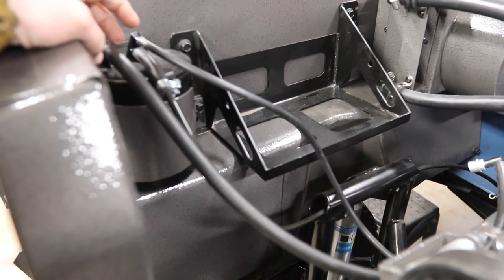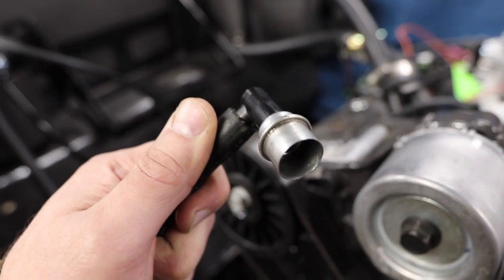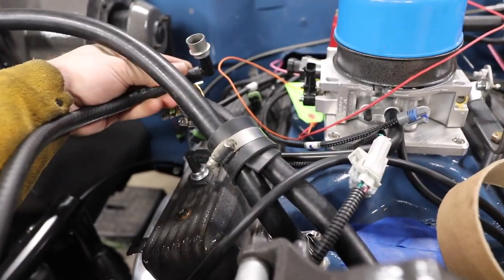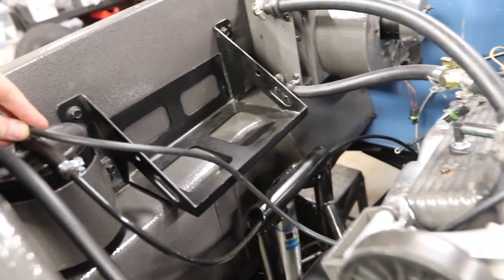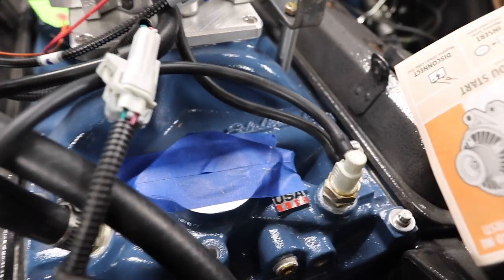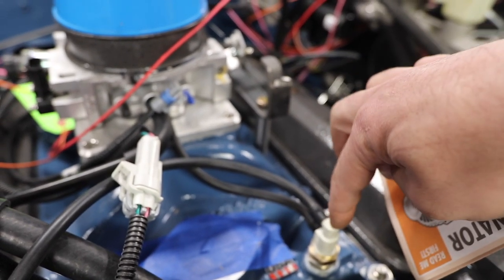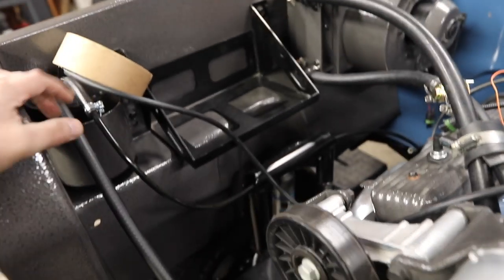The carb sucks those fuel vapors out and the air that feeds through here comes from this air vent. This comes with a cap that just allows air in but it's not filtered. So I took a PCV valve, hollowed out the bottom, took a PCV grommet and put it at the bottom of my air filter — that's my fresh air vent. You only want it sucking those vapors when the engine's warm, so in line I installed a heat-actuated vacuum switch, PV 72 or 71. One goes to the ported outlet on the throttle body, and when the engine gets to temp, this sucks. If it's creating too much vacuum leak, you can put in a small restrictor in line — it doesn't need much to purge the evap canister.